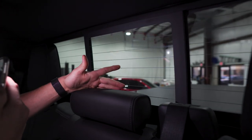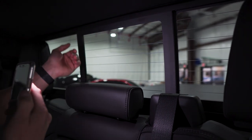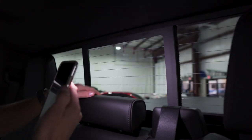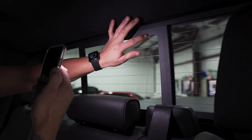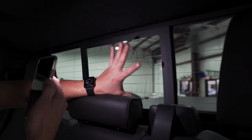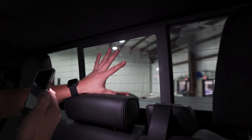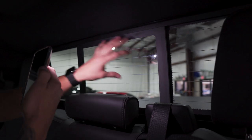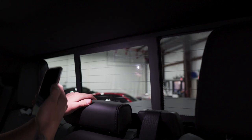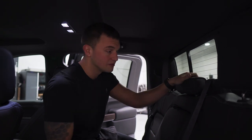With the center window that slides it's a little bit different. You can see we have a solid line on the inside, but the problem is that if you try to cut this on the outside, the sides of these windows are covering the quarter glass window as well as the gasket on the top and bottom. The best way is to take a tape measure or flat ruler, measure the height and width, bring those measurements to a table, and cut an exact square — just round out the corners a little. Measure it a little bit bigger and you'll be good to go.